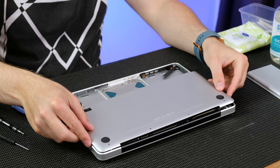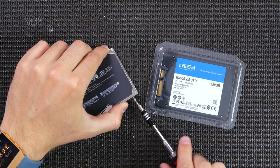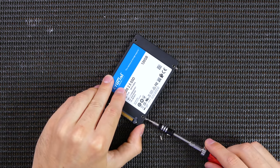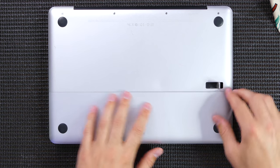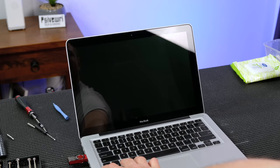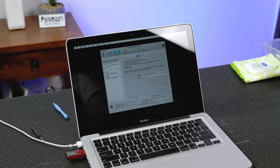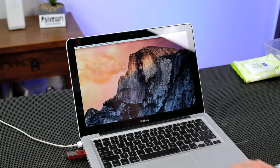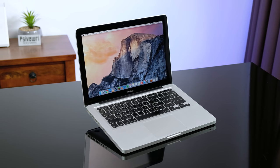To boost the laptop's responsiveness, I'm going to install an inexpensive 120GB Crucial solid state drive — I got it brand new for about $28 off eBay. Read and write speeds are going to be far better with this new drive. The battery and quick release cover can be put back on, and with it all back together, let's see if the laptop still works. Much to my relief, the laptop did in fact turn back on. The screen went quite dark during the macOS installation — perhaps auto brightness was on — but it detected the new SSD and I began the installation. Some time passed and we were back with a functioning MacBook once more.